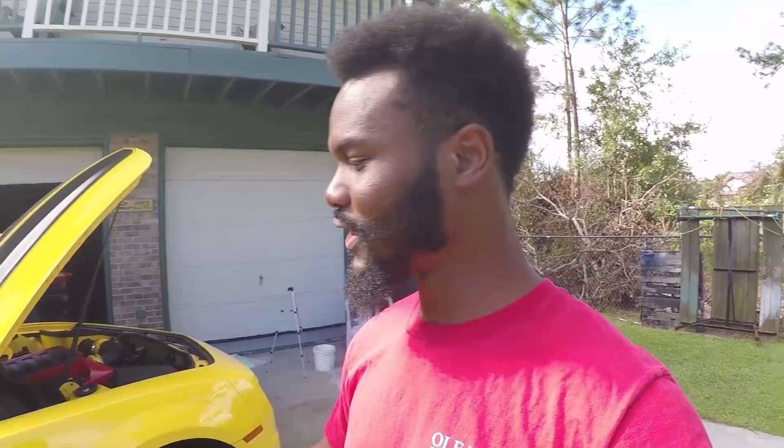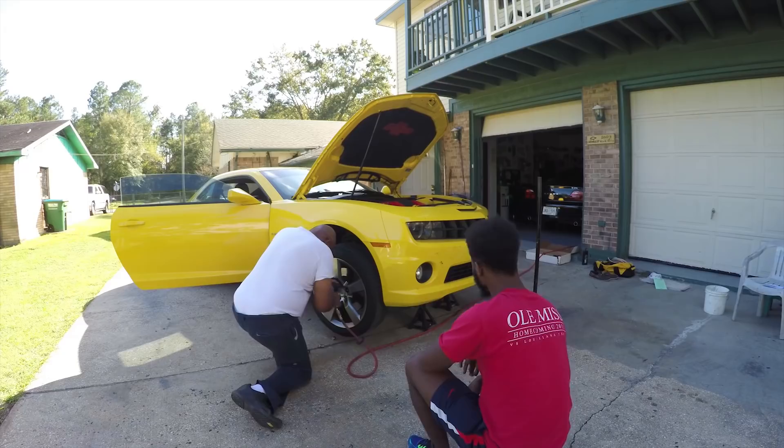Alright, we are going ahead and getting started. I got my dad helping me out today. When you put these kits on, essentially you're putting on a different door hinge that goes behind your fenders. So what you have to do is take off your front bumper and take out your wheel wells — we're gonna take off the wheels to get to that — and that's gonna allow us to get the fender off so we can get in there and get the new hinges in.